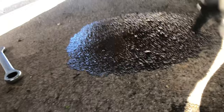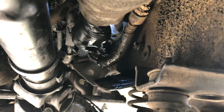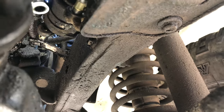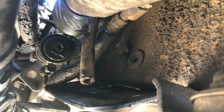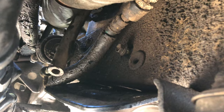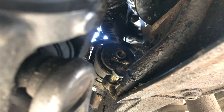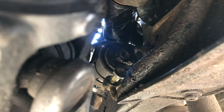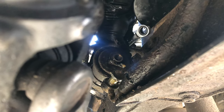That's about it to remove the two hoses from the fuel filter. Now we're going to remove the actual clamp — the holder that attaches it to the frame. We're going to remove that bolt right there with a 12 millimeter, and there's another bolt on top of the frame which I'm going to point to right now. It's a very tight spot so it's hard to film, but you can kind of see the direction where my wrench is going. I just removed it by hand from there — those are just two bolts attached to the frame. Pretty straightforward. Let's get it out to swap out the bracket.